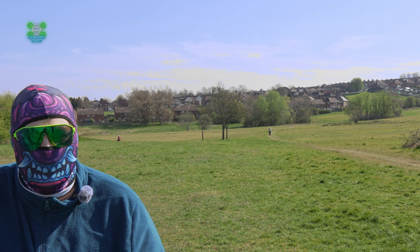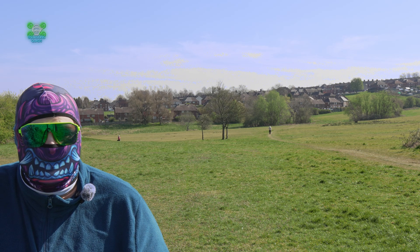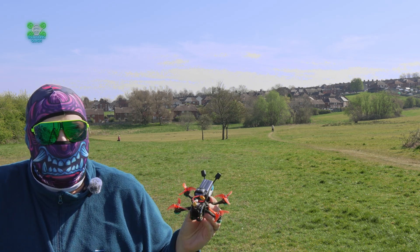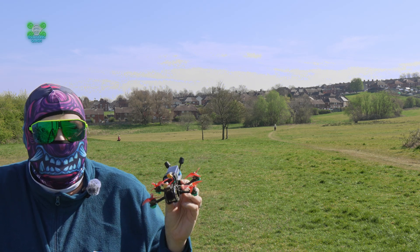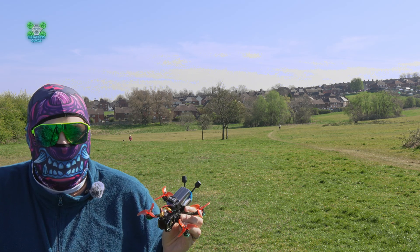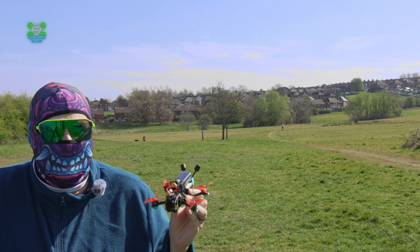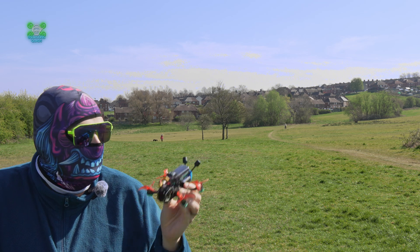Welcome to Part 2 of the Sub 250 Oasis Fly 25 DJI O4 Pro review. None of you knew there was going to be a Part 2 — to be honest, neither did I. When we first reviewed the quad, we set up GPS rescue and added a GPS to the quad. The original stock settings in Betaflight didn't quite give us enough thrust to be sure the quad would come home, so we changed some settings. But the eagle-eyed of you will have noticed in the video — we didn't actually test it. So job number one: let's go and test it right now.